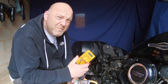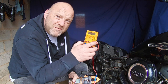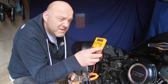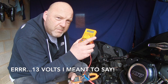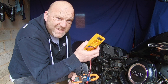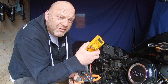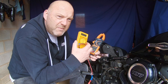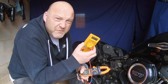At low RPM the alternator may not provide enough power to overcome the draw of the electrical systems from the battery, which is why you always measure at 3000 RPM or above idle. To get 13 volts, just get your multimeter, put positive to positive and negative to negative across the battery terminals, set it to voltage, start up the bike, and you'll see when you get 13 volts or above. Note the RPM, then match that RPM when measuring amperage. It's easier with two people so you can run the clamp meter and multimeter at the same time.